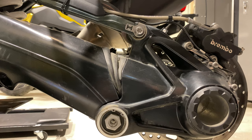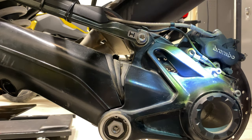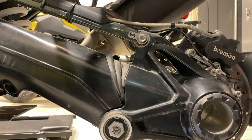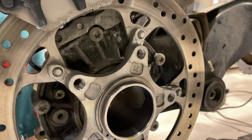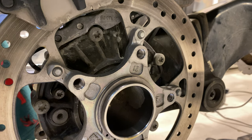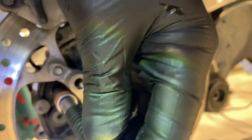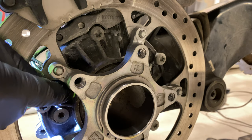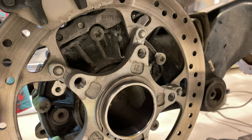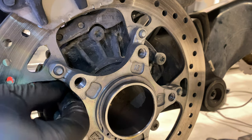I finally made the smart decision to put gloves on. We've got two T40s right here — you're going to break these loose. But first, go around the other side: there's a T30 here which is the speed sensor, and it really should not be in there very tight. Once you pull it out, just note that it screws back into this hole right here.